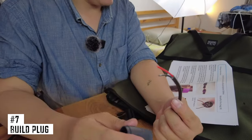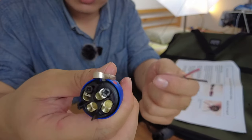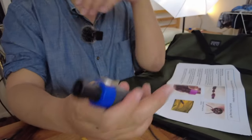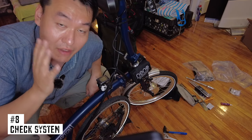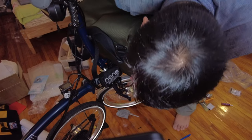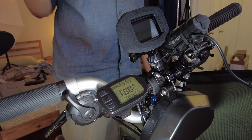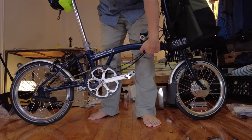Now that the wire is in, we slide the frame back into place. One of the last steps is to build the plug itself that goes into the battery. Take the cap, put it over the wire, take the cable grip over the wire, and use the screws inside to hook the wires permanently to the plug head. That's the plug and bag complete. Now we conduct our full systems check — plug the battery into the bag, then mount the bag onto the bike. It just clicked into place. This is the moment of truth — everything is working, everything is on! The connectors are all good. Let's give it a shot!